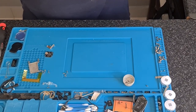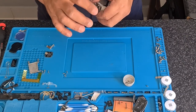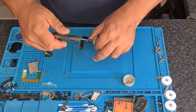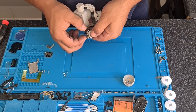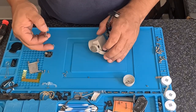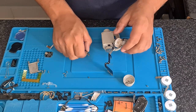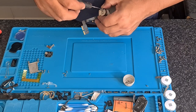Another method is to heat it up a little bit — obviously without burning or damaging the flex. I think I'm going to pull this bracket because it is quite badly bent and needs to be replaced as well. It should be at 90 degrees, so that bend is not good. I'm not going to try to bend it straight — it's much easier and quicker to replace. Found a replacement. Looks much better. We'll have to test it to be sure it doesn't chafe against the arm.